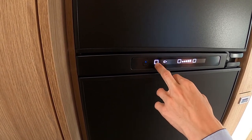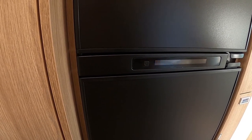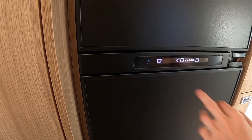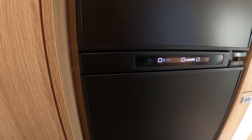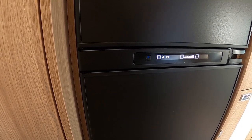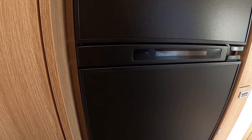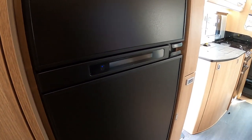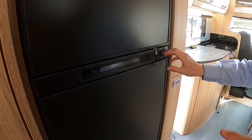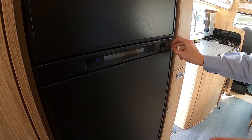You can override Automatic if you wish, but I would leave it on Automatic. The idea with the 12-volt setting is to cool the fridge the night before you go away — hook the van up the night before, put your shopping in, let it go nice and cool overnight. When you do start to drive, the fridge will stay at the same temperature it was when you departed and won't get any warmer or colder.